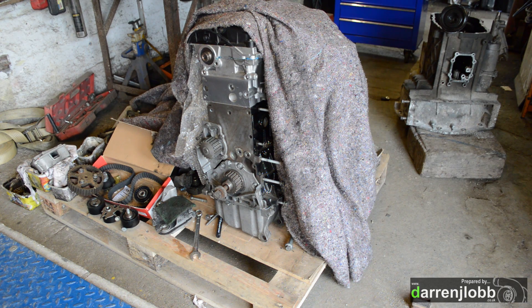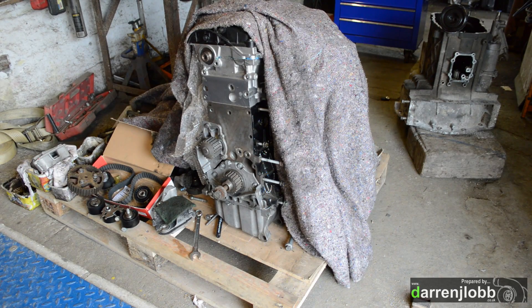We're going to put a hole in there and then get the belt all mounted. I'd like to get that belt on and timed up so that can be forgotten about, and then I can go on to actually mounting the CP3, which I'm going to have to make brackets for, and which will be running off the auxiliary belt. That's my basic plan - we'll get the drill out, mark this up, and see if we can make a hole.